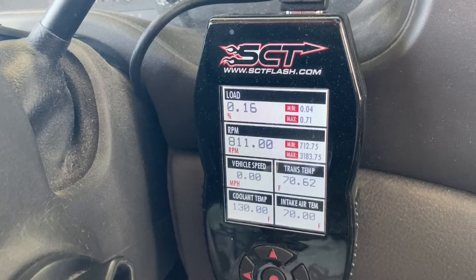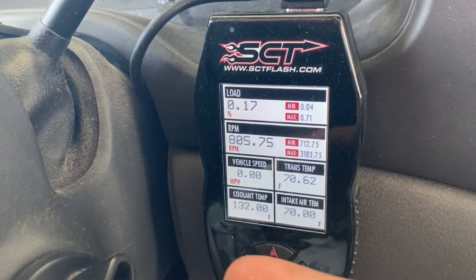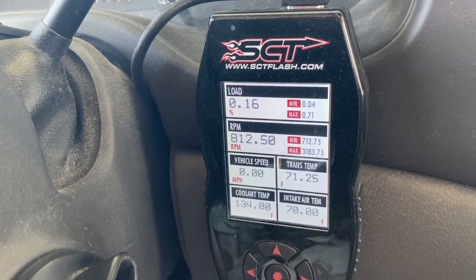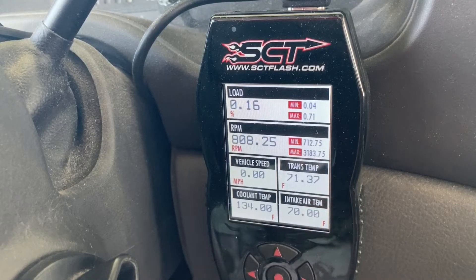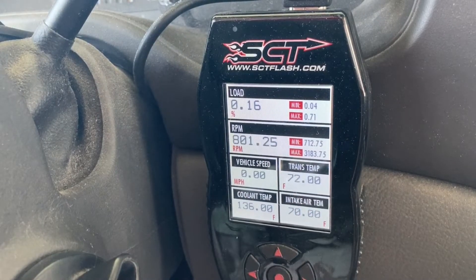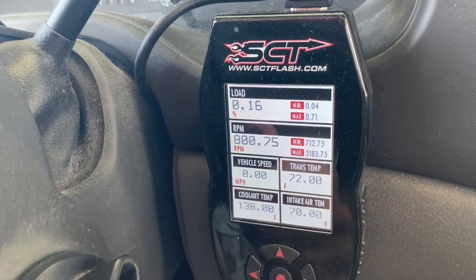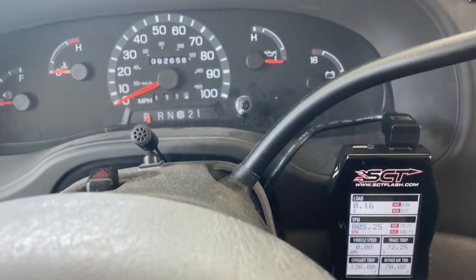I also chose outside air temperature. The intake air temp is roughly equal to the outside air temperature while driving, though it'll climb far above ambient if you're sitting parked and idling. Usually it runs about two degrees above ambient — which is actually why a cold air intake is a waste of money. As I watch this going down the road, the ambient temperature is usually only about two degrees cooler than the intake air temperature reading, so that air isn't heating up much. This display is super helpful, always on while you drive.